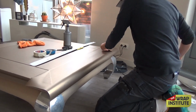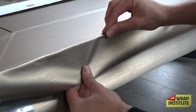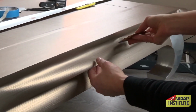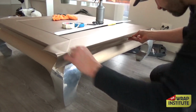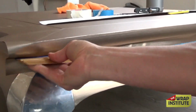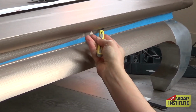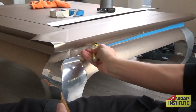Now what's interesting about this particular top, it's got a little curve right there, hard edge, 90 degrees, so my free hand pulls down while I really seal the corner. Very, very important to do. If you make that corner loose, the material will bridge. Then I squeegee to the corner here, left and right. No need for heat, because I'm going to do a butt joint right at the edge right there. So once I squeegee into the sides, I can finish the bottom, and this bottom is a tuck and cut, and very good clear line to hold my blade right there.